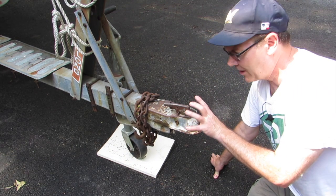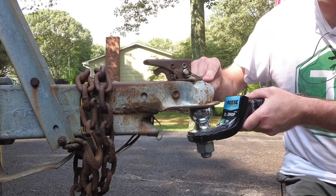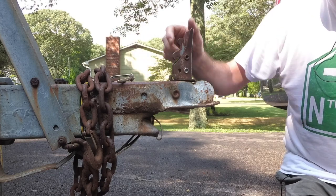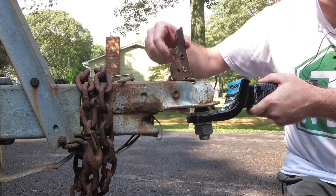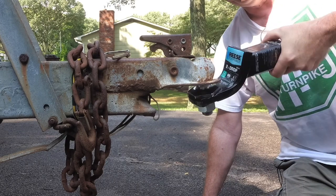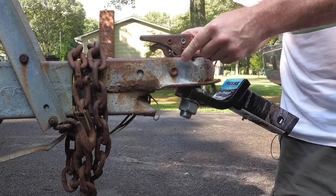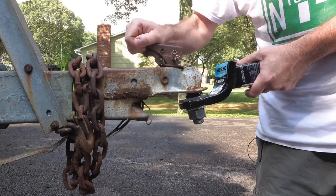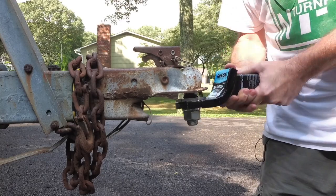Let's talk about this mechanism right here. This holds a tab that when it's down keeps the ball from going all the way up in there. This is a locking pin — when you take the locking pin out, this goes up. When this goes up it releases the tab and then the ball can go all the way up into the receiver. Then put this down and that locks the ball onto the receiver. In order to keep this from bouncing upward you put the locking pin in here. When you have this locking pin in, the latch can't release. The latch has a tab that holds the correct size ball into the correct size receiver, keeping it very secure.